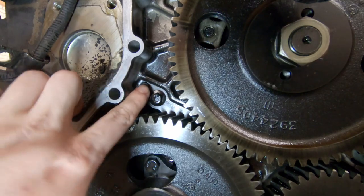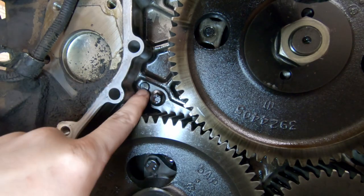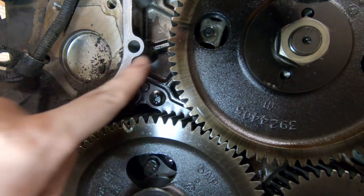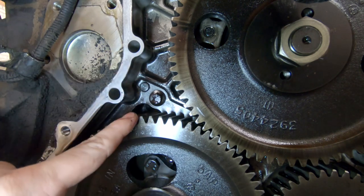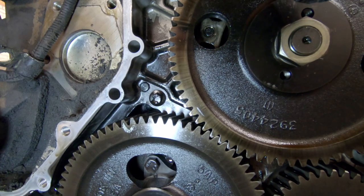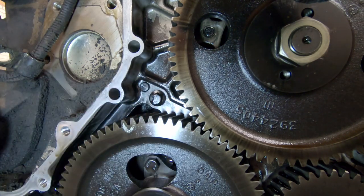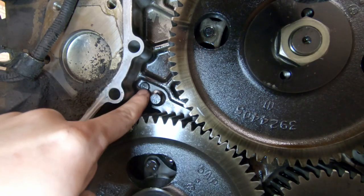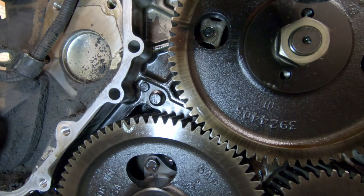Here is the little bugger that causes all the problems — this little pin here. It's a dowel pin used for aligning the front timing casing with the engine block. Aligning pins are good; they help you get everything on exactly where it needs to be. The issue is that because of engine vibration, this little aligning pin will work its way out, fall down onto the gear, and the gear will shove it into the side of the timing case. You'll hear a horrible bang and this side of your timing case will be damaged. The fix is pretty simple — you take a small plate and use a timing bolt to hold the dowel pin in so it can't slide out. They sell kits for this, but I'm just going to cut a plate myself.